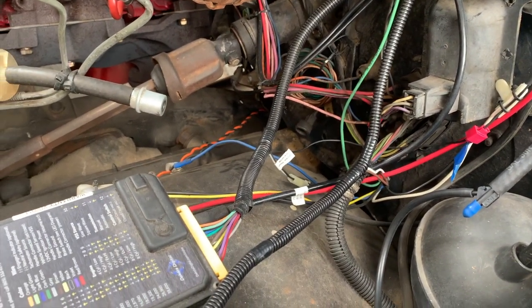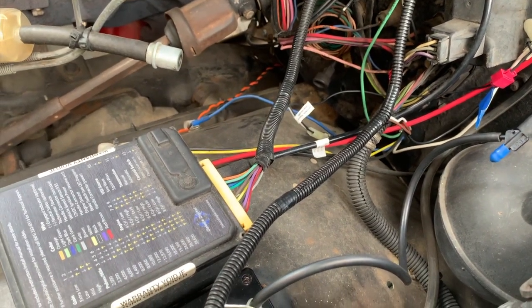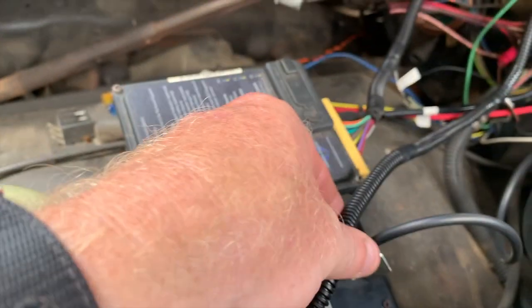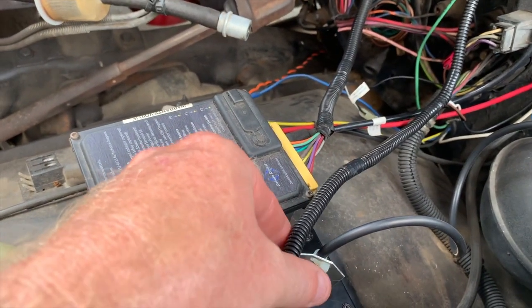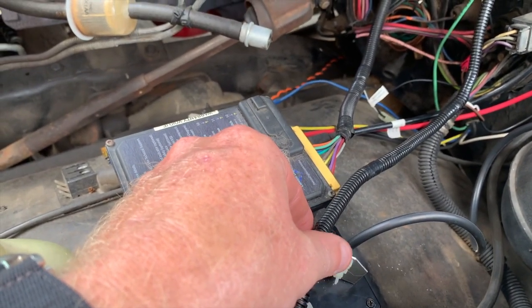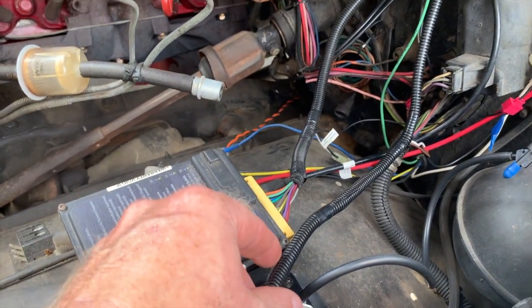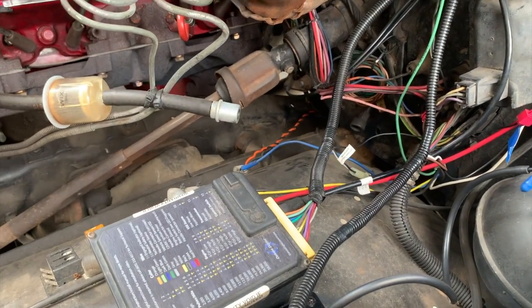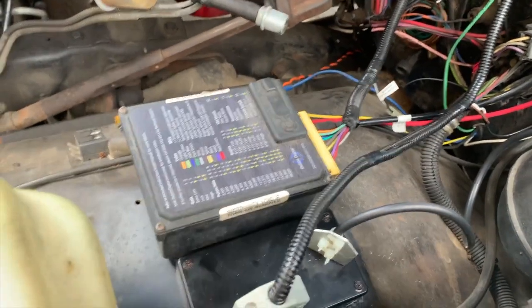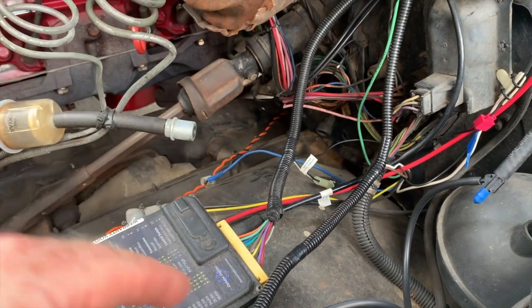And it just needs a vacuum indicator, because when vacuum drops to 0, well, actually 4 inches of vacuum, this thing automatically goes to high stall. There's 5 wires in here, so one of them's ground. 2 of them go down to your transmission for kickdown and for switch pitch control. And one of them's tied to your kickdown, and it tells the engine when to kick down. And when it kicks down, it automatically goes to a high stall. And so that's kind of neat, right?